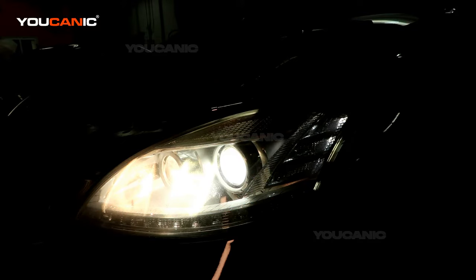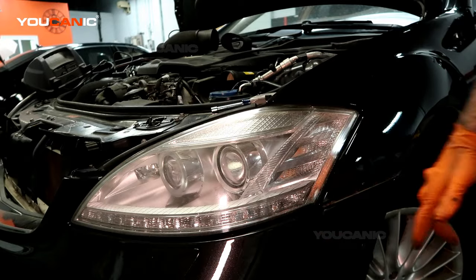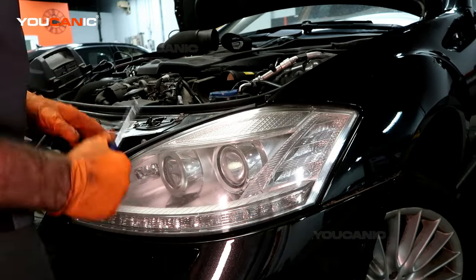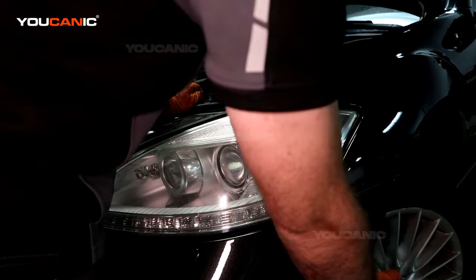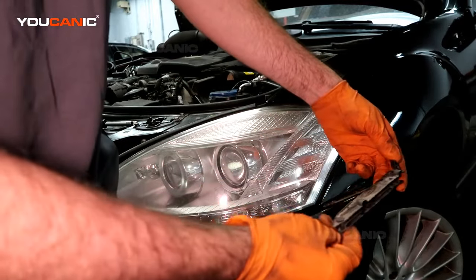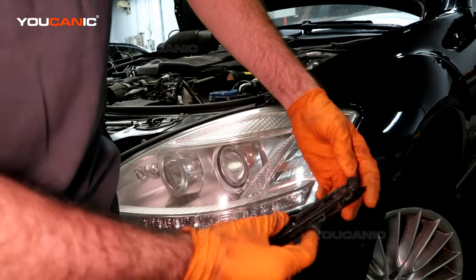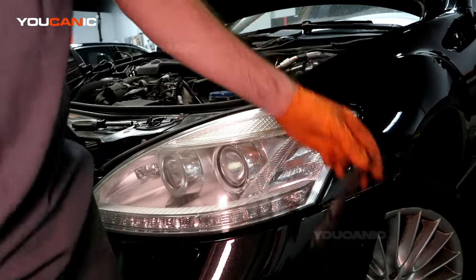I find it easier than trying to deal with all the mess up in there. So I'm going to go ahead and turn off all the lights. To start with, there's this one bolt here on the bumper. Okay, and then there was a screw that's right up here that's been removed, and some push pins, and then there was this metal plate here that's clamped up inside there, and it holds these two pieces together, being the fender and the bumper. If you just get a screwdriver right in here and kind of push it out, it'll now come apart.